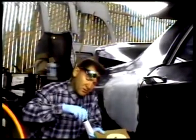As a little tip, I use different colored hardeners. So when I'm sanding, I know when I'm at different levels, different layers. We're going to reapply, make it all uniform and smooth. We don't want two colors, we want it mixed. Perfect.